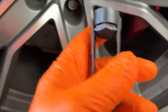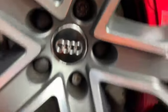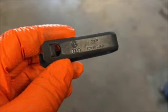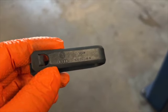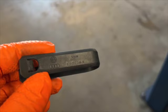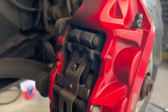I'm going to get the little cap puller — these are a must with these — and we're going to whip out all caps. There's one missing for the locking nut which is cool, so out these come. The wheel bolts on these are 17mm. Also this is a genuine Volkswagen Audi Group tool and the part number for this particular thing is 8D0012244A.